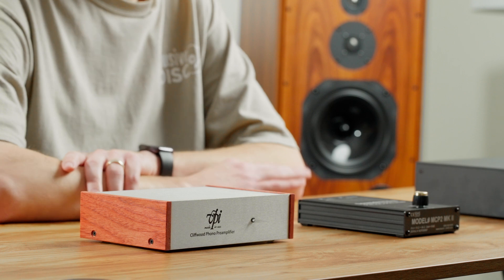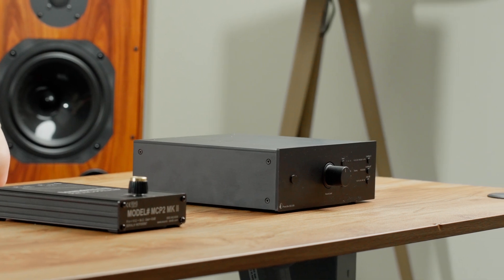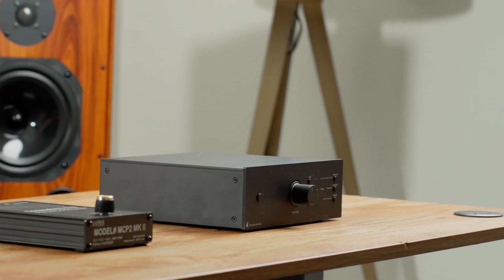In summary, there are no shortage of great phono stages out there. Today we looked at three different kinds: moving magnet only, which is a really good unit if you have a moving magnet cartridge; a dedicated moving coil stage like the SoundSmith, which is built great and sounds amazing if you want to get the most out of your moving coil cartridge; and one that does both for flexibility. An added touch of the Pro-Ject unit is that it allows you to record your vinyl digitally via USB out — great for added flexibility.